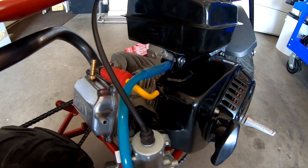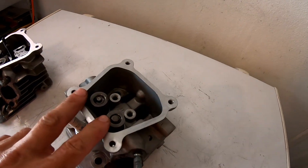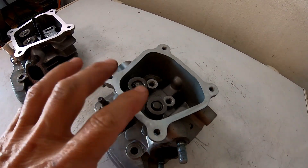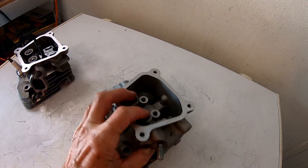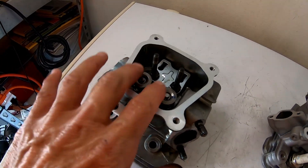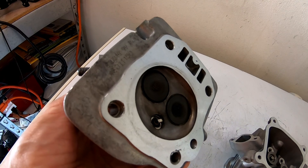I'm going to run this first, then pull the head off and install a totally stock GX160 head with stock valves. The only thing done to it is 22-pound springs because of the mod 2 cam in the Predator, and it has a 14cc chamber. Then I'll run a basic run-of-the-mill Predator head with 22-pound springs but stock valves and everything else.